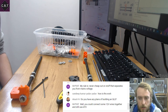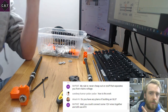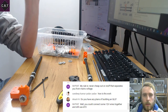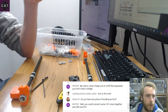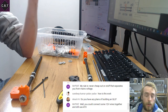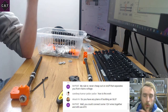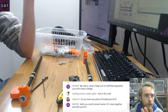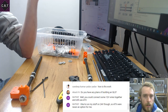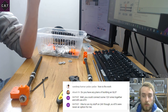With an ATX power supply, what I wanted to do is basically take the cover off, look for the points where those 12-volt wires go in — there are obviously a number of them — and put in some pretty fat gauge wires. So all those wires just come into two large-gauge wires that I can then use as I like, or maybe split them a couple of ways. A high-quality ATX power supply could run like 750 watts without a problem.